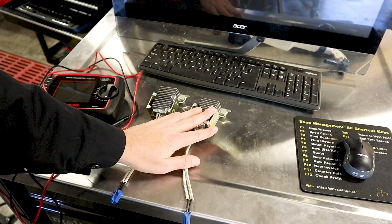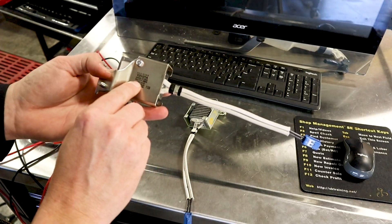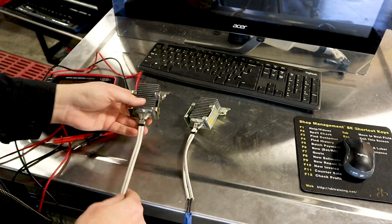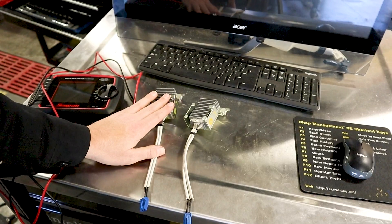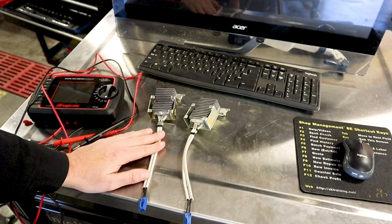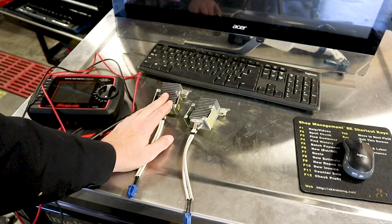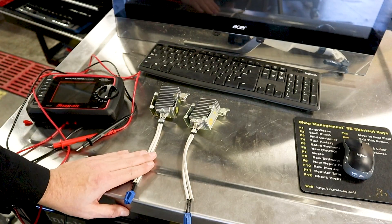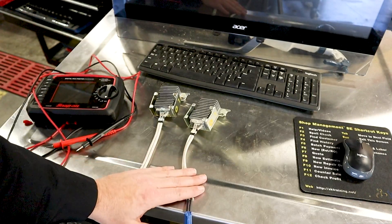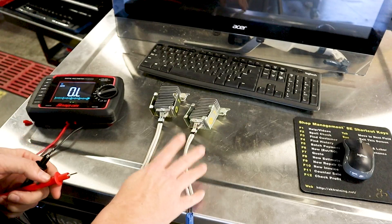This is the new resistor and this is the old resistor. If you look on the back, it reads 193.6 milli-ohms, which I suppose is a specification. I've tried to look at specs through ShopKey, just googling, and through Identifix, and I could not find a specification for this resistor. And if the specification is in milli-ohms, I don't have a milli-ohm meter — just a standard ohm meter. So what I do is measure the old one and the new one and see if there's any difference. The new one reads somewhere around 200 to 300 milli-ohms, and the old one did about the same thing. So the choice is up to you if you want to replace this.